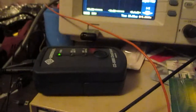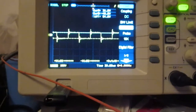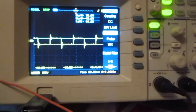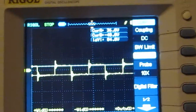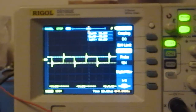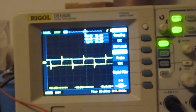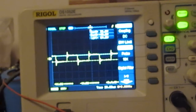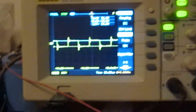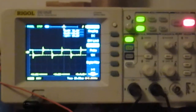I wanted to test this thing on my oscilloscope. I tried it on the little ones and I think it was out of bandwidth. It looks like it's about a 15 kilohertz square wave that they're using for this, and it's about 84 volts. So 84 volts is enough to kill your computer in your car if you hook it to ground. Maybe if I unhook all the cables and don't hook up the ground, we'll still be able to see the signal and not blow out the components. So this seems like a risky thing to do — if you want to do this with your own car, you do it at your own risk, because there's a good chance you might wreck something.